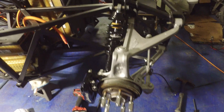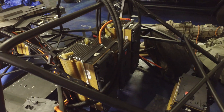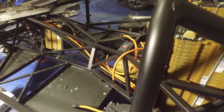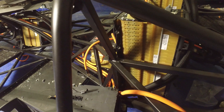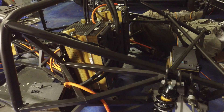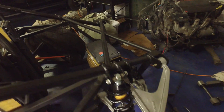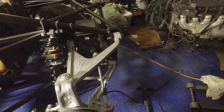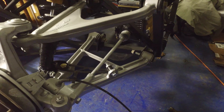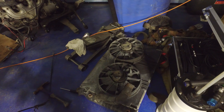The hoses are routed up through the chassis along with the power cables for the batteries and motor. This stuff isn't permanently mounted — just laid there for sizing. I've got some T-fittings on order for each motor, waiting on those to arrive. I still need to get the Tesla drive unit back here and test fit it for final mounting position, but I needed the suspension in place first so I'd know where the axle is going to have to go.